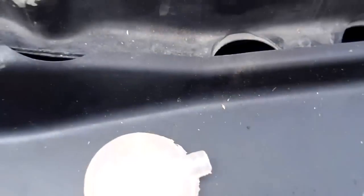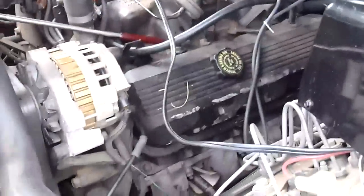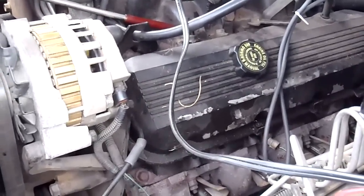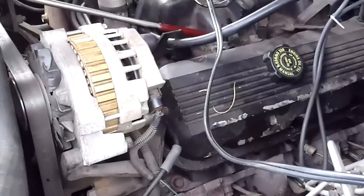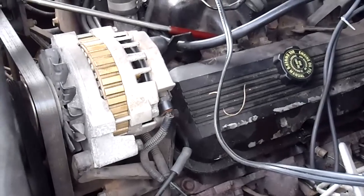This goes in the end of that. So I pulled it out of there and I stuck it in there. When air goes through it, it squeaks. Go down here to the number one cylinder and shove that back into the spark plug hole. When I turn the engine over on the compression stroke, it squeaks. And now we're top dead center — it quits squeaking.